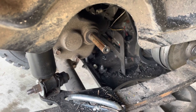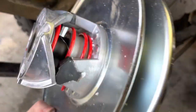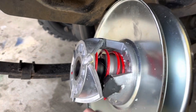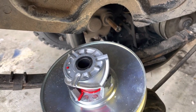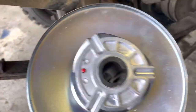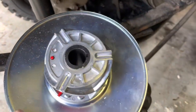Now we have the new one and we'll slide it on and see what happens. This is our new clutch — I believe I got this from Vivor. It has the red heavy-duty spring in it, which is what I really wanted. With these big tires on here, whenever we begin to accelerate with the old clutch it gives a little bit of a bounce, and I'm hoping this will resolve it. You can see it has the area for the pin — let's get this baby in.